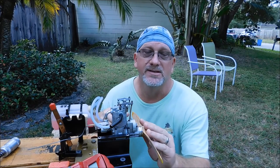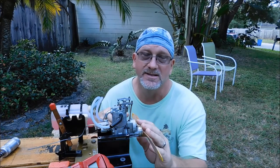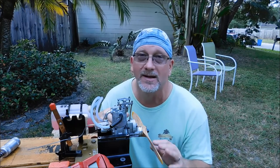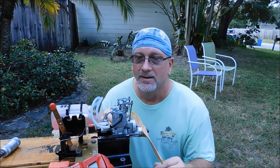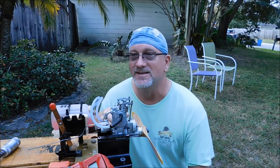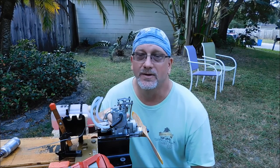And I always stick with this same Master Airscrew 11.6 prop, just because if I were to ever put this in an airplane, this is the prop size I would use. Now, granted, I could get higher RPM if I go to a smaller prop, but that isn't the point. I was looking for an 8,000 RPM reading, as I believe that's the reading I saw in a magazine article review of this engine. But anyway, it's always fun to run this engine.